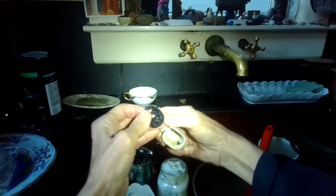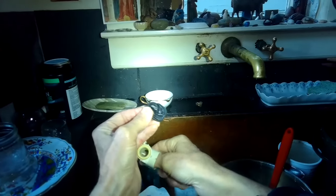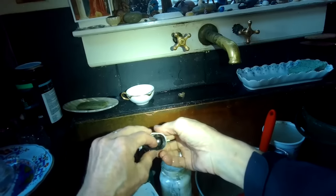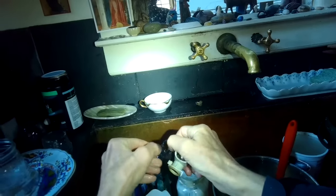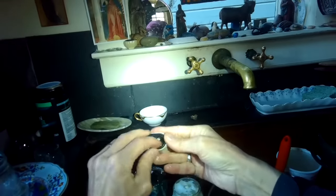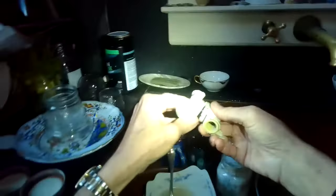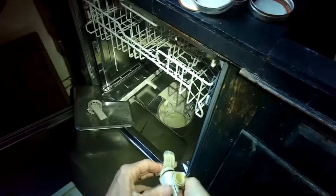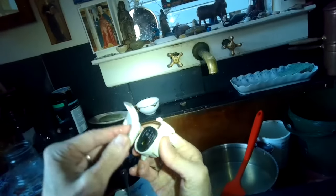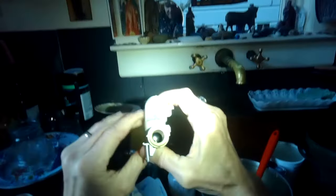There's the ball bearing, so I'll go ahead and clean that out a little bit — there's just a little bit more stuff caught in there. Then I can put the ball bearing back in and put the rubber gasket over that ball bearing, and then put the other piece back together — it's just put in by friction. The whole gasket is pointed to the right and the opening of the one-way valve is pointed to my left. I line up the other half, grab it, and pull the two ends together. They're not glued, just held by friction. That little tab goes into that rubber opening — squish them together really good and then put it back in, and that's probably gonna cure our problem.